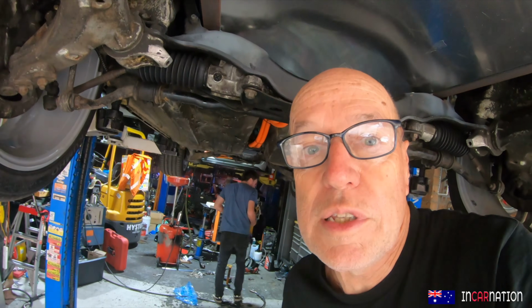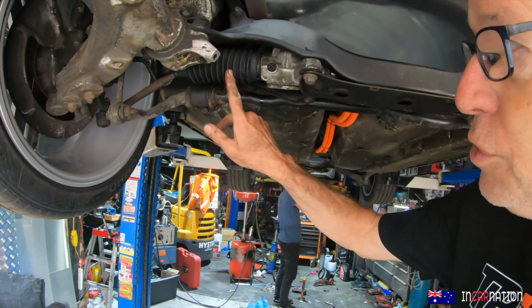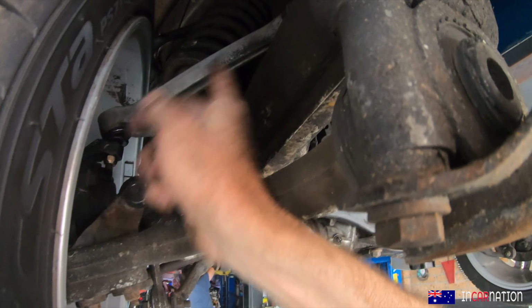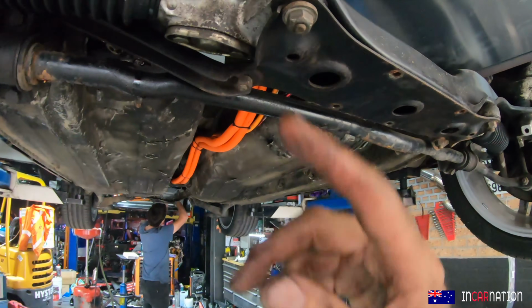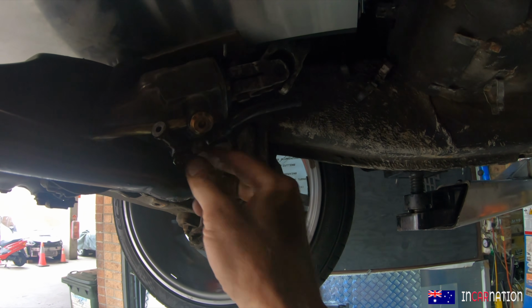So one thing that's nice about this project is we're not changing any of the steering geometry. You can see here's the original Porsche rack. We've got new boots for it. But all the tie rods and pickup points, everything's exactly the same. New upper control arms because the old ones were just, the bushes were gone. New brakes. But using this rack's good. It is a power assisted rack, of course, and there are the high and low pressure fittings that go to a power steering pump.